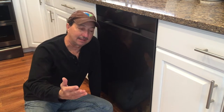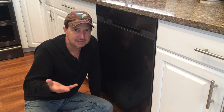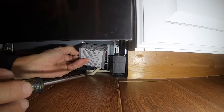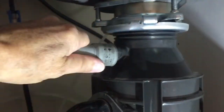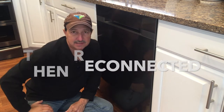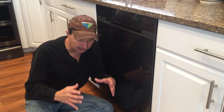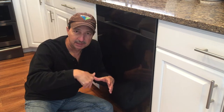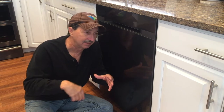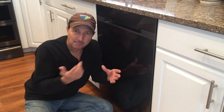I cleaned up the puddle and decided to pull it out and see if I can figure out where it's leaking from. I disconnected the water line, disconnected the power, disconnected the drain hose, and set it in the middle of the floor on 2x4 blocks so I could see underneath it. I ran it through a complete cycle — not a drop. There's a little catch pan on the bottom of this unit that has a sensor in it. Mine didn't have any water in it. That sensor is what gives the LC code — it's the leak check mode that the system goes through. Mine didn't trip that.